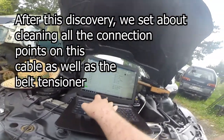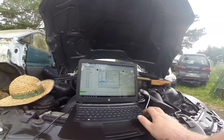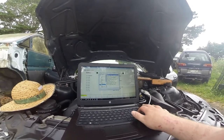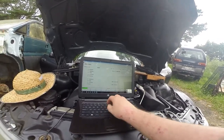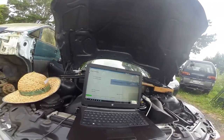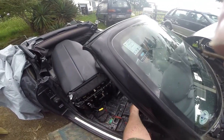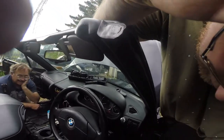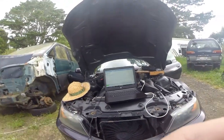That moment of truth. Shift F8. E36. Body airbag. Language just doesn't match - that's okay. F4. Clear the memory. Memory's getting cleared. That's good. Engine off. Back on. Light is gone. Yes. F1. No codes found. No codes found.